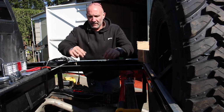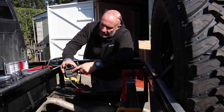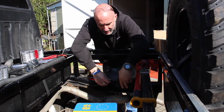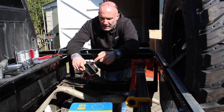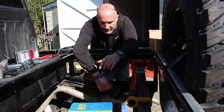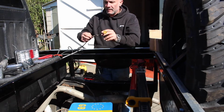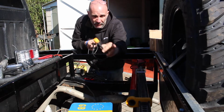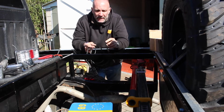Right, so we're getting there, guys. We've taken those 8 cables and run them now into this waterproof box, which we're going to basically rivet to the chassis, and then we're going to have our 2 5-core leads coming in on the top and the bottom for the left and the right indicators. So Paul's just been with the soldering iron, so we've just got some 5-core cable here which we'll cut to length so that we can run obviously one from the far side and one from this side.